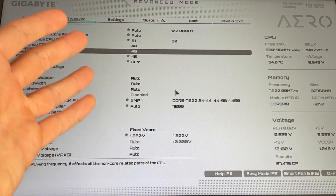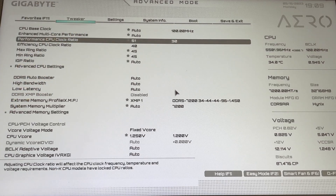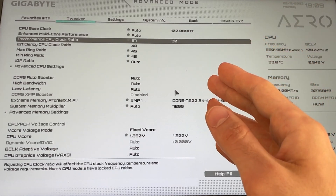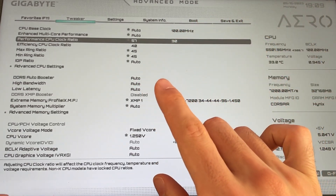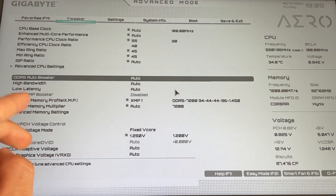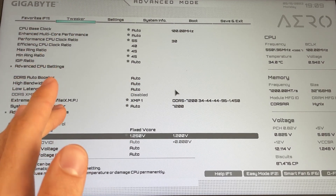For the cache, don't go higher than 45 — it's not needed. For the performance cores you can set anywhere from 55 to 57 but you'll have to test this. If you want to copy my settings, put them to 55 — on most CPUs they will work at 55 with 1.325V on the v-core. If you want 57 you might have to go as high as 1.375V.